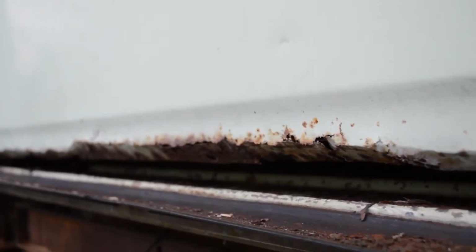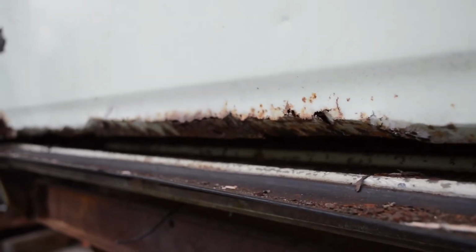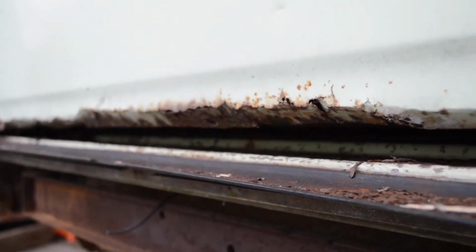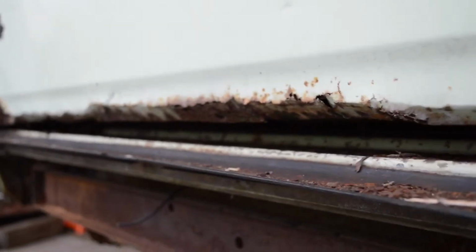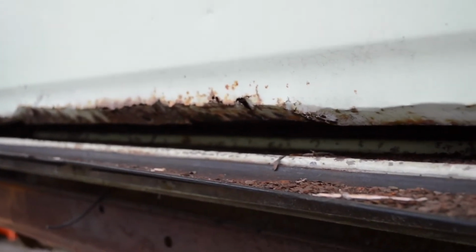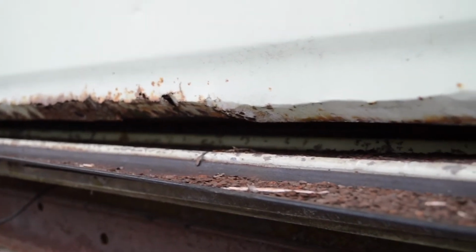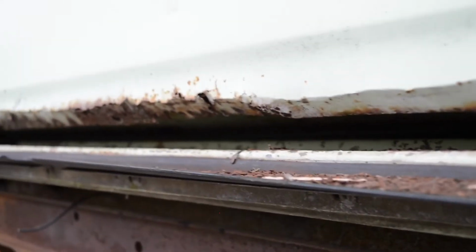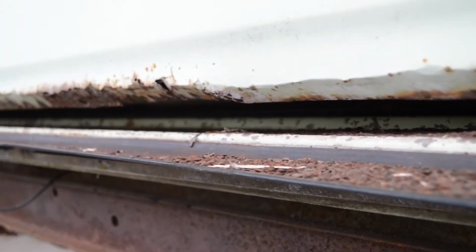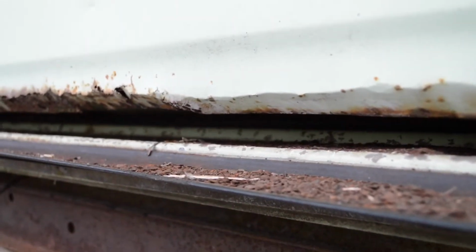And for the longest time, the tailgate would only open to the side, because they marketed this as a three-way tailgate. You could open it to the side with the window up or down, or you could open it down like an actual truck tailgate. And for the longest time, it would not open like a truck tailgate, and something at the bottom was catching with the rest of the body. So now it opens like a truck tailgate, but this tailgate is pretty wasted.